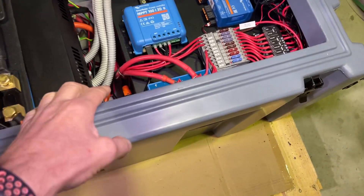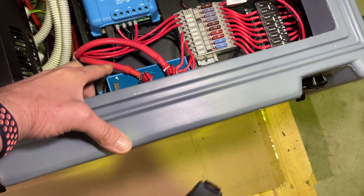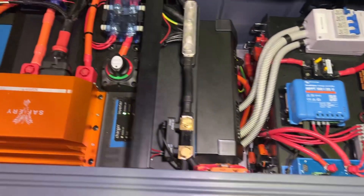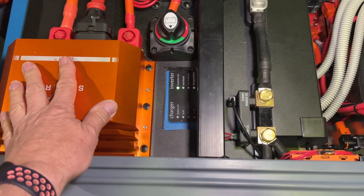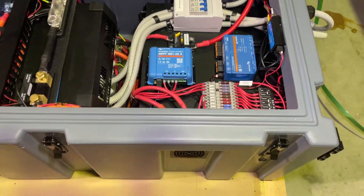We've got a very large smart battery protect here — 100 amp — because this is running the jack stand. So this pack in the back he'll be able to jack on and off with it. We've got the Scotty ignition switch just here, so it can be running all the time on the 48 to 12, and in here a 5000 watt inverter and 600 amp hours of lithium.